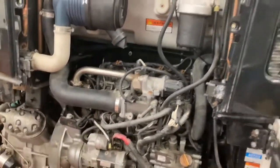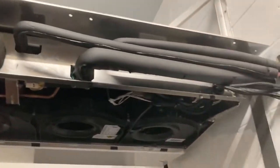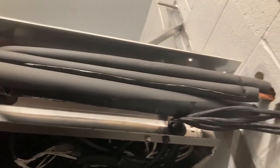This applies to every precedent unit or tractor and truck unit — you're going to look for all of this stuff. But if you've got a multi-temp, you've got a few more things. On a multi-temp, you have remote evaporators, and here we have one at the TK Education Center. You've got to look for connections in these too. There's a bunch of wiring zip-tied out of the way, electrical connections, and refrigeration connections. Just like with the main unit, give it a good going over and make sure there's nothing broken, loose, or rubbing that can cause a problem.